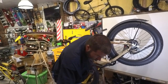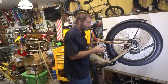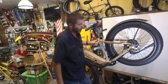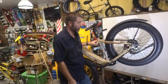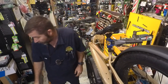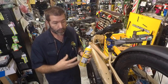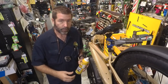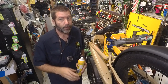The next thing we've got to do is take it out for a test ride and make sure the brake pads are not contaminated. There is some fluid — the brake pads look like they were okay, but you really can't tell unless you take it out for a test ride. If it is contaminated, this is going to be using a Shimano-type brake pad and we can just match it up with the Shimano pad. Now that we're done with the brake bleed, we want to make sure that we clean it thoroughly using a good bike degreaser — I suggest the Finish Line Speed bike degreaser, it works really well and cleans up all surfaces without contaminating the brake pads. If you enjoyed this video, please leave a thumbs up, tell your friends, check out some other videos, don't forget to subscribe, and I'll see you in the next one.